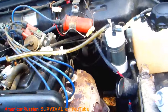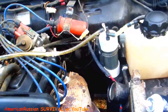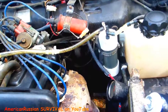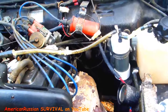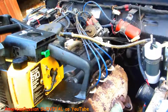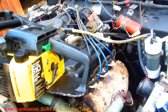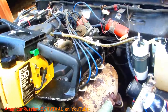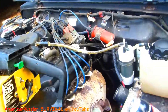Just want to tell you - if you have a computerized fuel management system with electronic ignition and fuel injection, this HHO probably isn't going to do a damn thing. It works pretty damn good with a carbureted car with a simple ignition system, no computer. Because if I put a computerized management system on this thing, it would get much better mileage than the HHO. When I added the HHO to the simple carb setup, it did get better mileage - maybe 10 to 15 percent better, not double.